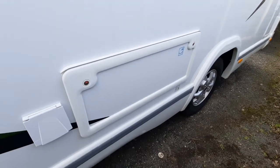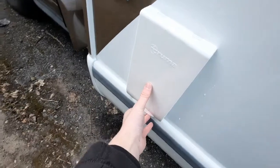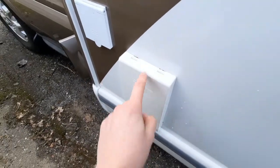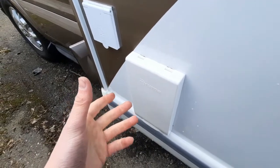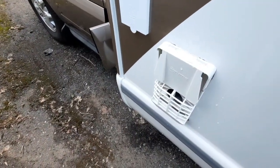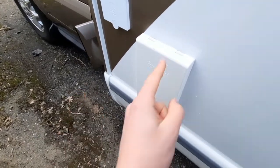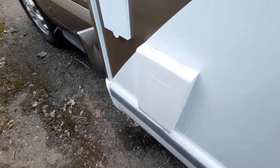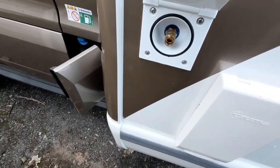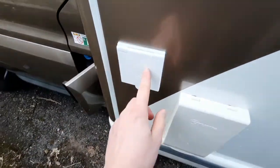Moving on from the drain down point and the convenience locker, you'll notice your hook-up point here for your 230V mains electric. Coming across, you've also got your Truma vent — this is really important. As you're travelling, this cap needs to be on the vent to stop any dirt or water getting in. However, when you are on site, you need to always remember to remove this cap, because in essence that is the vehicle's chimney. If you forget, you'll gas out the system and have to reset the entire boiler system, so always remove that cap when in use. Finally, you've got your external shower point here — the external shower from the garage just connects onto there via a bayonet fitting, and that'll only work once you've got your pump on.